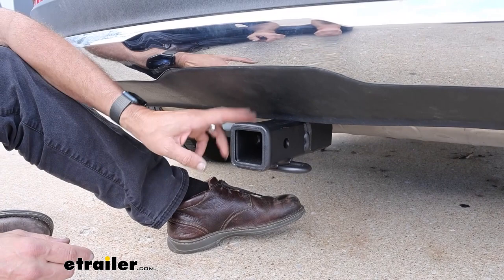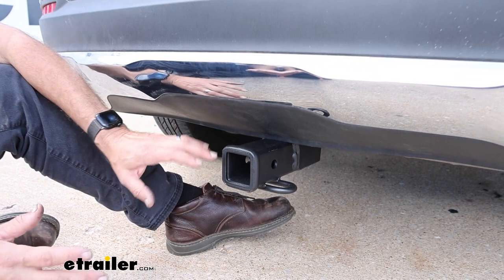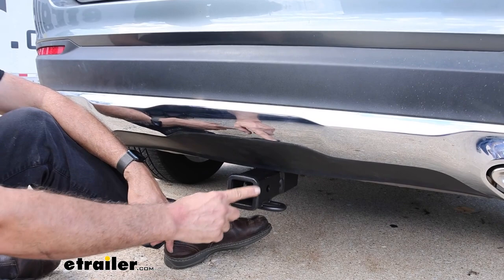What we're looking at is it's going to be powder coated a flat black, unlike some of the other trailer hitches out there that have a gloss or semi-gloss finish. This one's flat black and makes it disappear under the car. This is going to be a hidden cross tube style, which means you're only going to see this receiver portion under here — everything else is tucked back behind the fascia. This is a Class 3 receiver hitch, meaning the opening here is 2 inches by 2 inches, and our hitch has a reinforced collar on it.